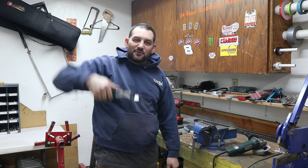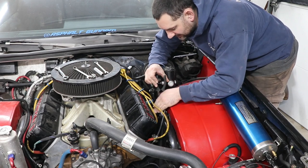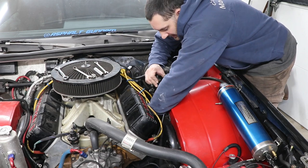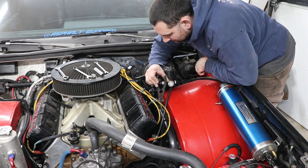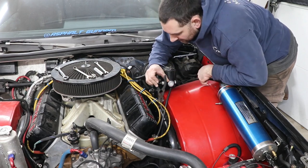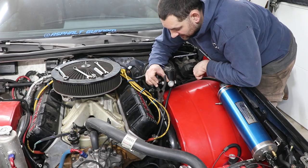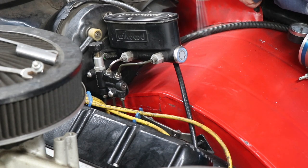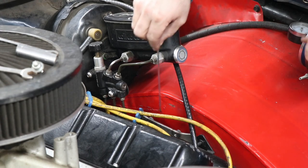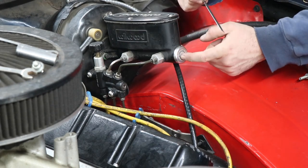I also rounded the edge most likely to rub on my arm and wrist when working on spark plugs, so there shouldn't be any sharp edges. This is where I'll be welding the bracket — it's pretty tight down in here, but I should be able to get my hand in to work on spark plugs and header bolts without issue. That's why I want this to be a removable bracket, because a big permanent bracket would make it a real pain. From measurements, it's roughly six inches up to the center of the master where I want to support it, about three inches longitudinally on the bracket, with about two inches of step over.